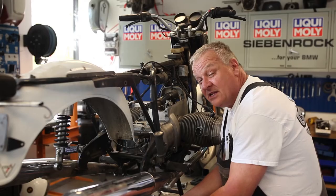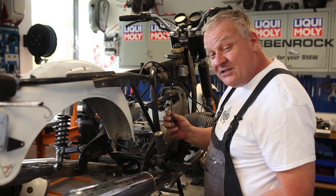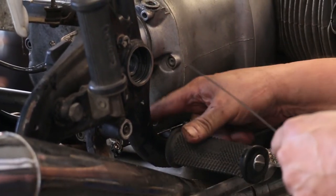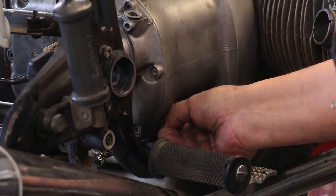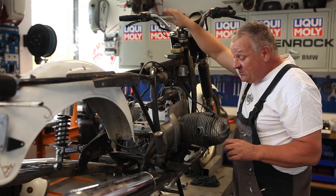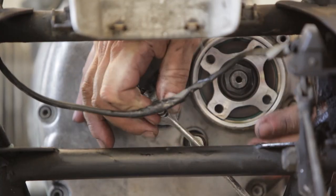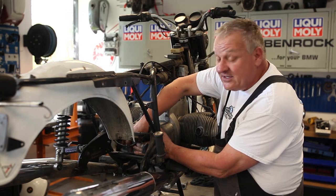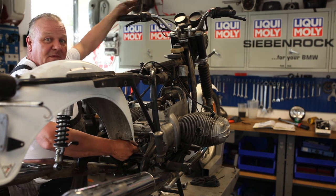There's a base adjustment you need to make on the clutch cable: measure 202 millimeters from the deepest point of the cutout for the cable barrel to the metal end of the cable. I use a cable tie or piece of welding rod cut to exactly 202 millimeters. Adjust the cable length to achieve that. Once set, use the rear adjuster to set free play of about one to two millimeters at the lever, then tighten the lock nut down. That clutch is properly adjusted.